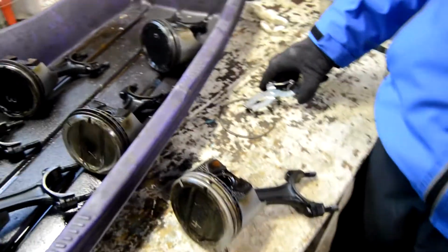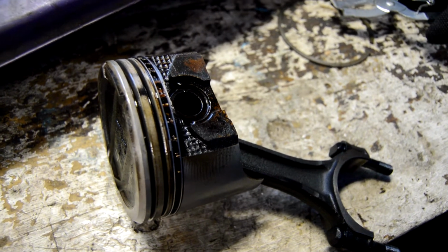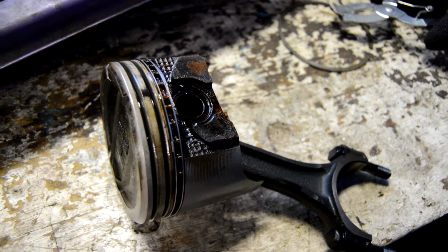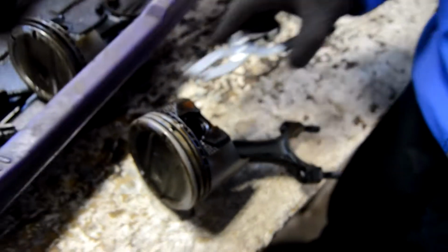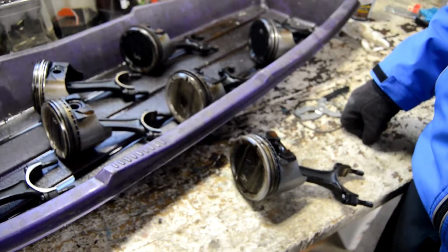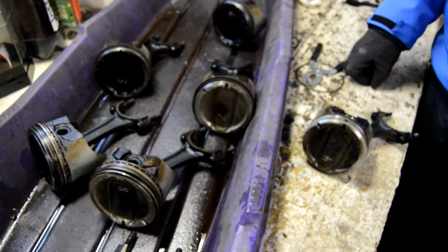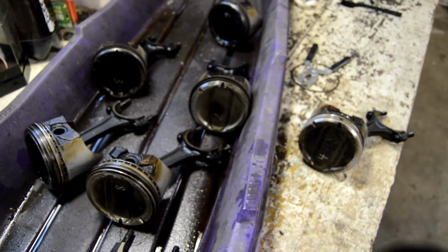Okay. So, this is what I'm wondering, like the interesting part here to me is this oil ring that's 3 layers. Yeah. Are you going to use that same tool or just pry them off? No, you can't use the same tool. In that one, you got to walk them off. Okay, so you have to use a little screwdriver for that. Let's go ahead and do that. Okay, I'll go get the screwdriver.